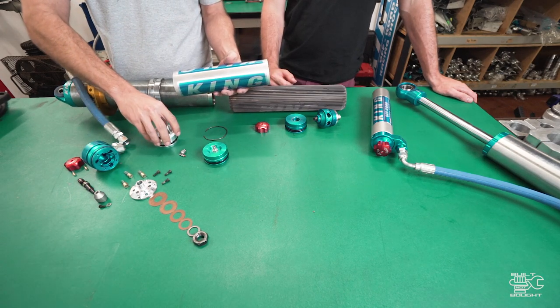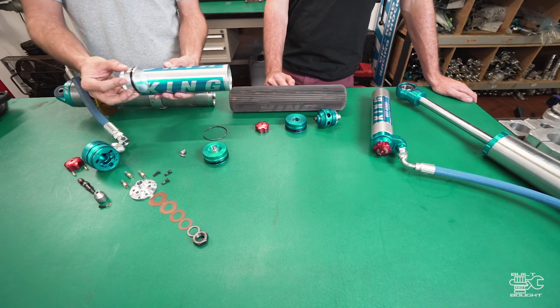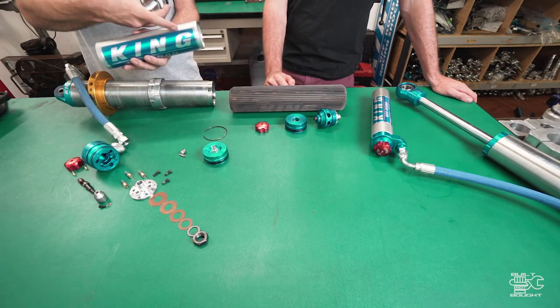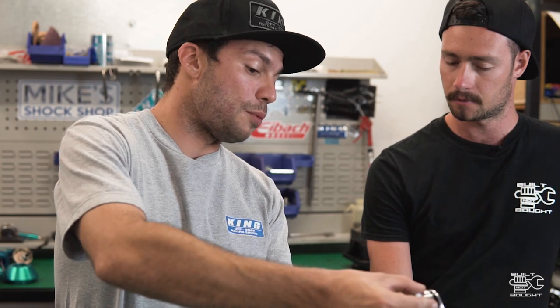That wear band sits on there and just travels up and down. You're saying nitrogen - do all shocks have nitrogen in them? No. Most of the high-end shocks will separate your gases and your oil - it stops aeration, and that's all it does here. There's no actual oil in the reservoir itself. The oil finishes at the floating piston - all this hose will still be full of oil. The only oil that actually goes in the reservoir is the oil that's displaced by the size of the shaft as it goes up. That piston might end up about here at full bump.